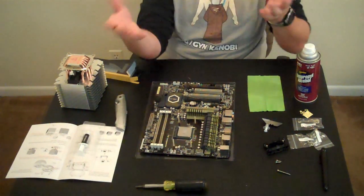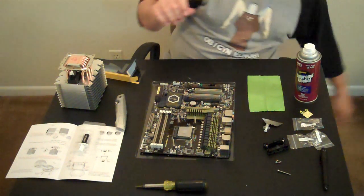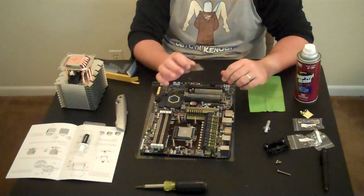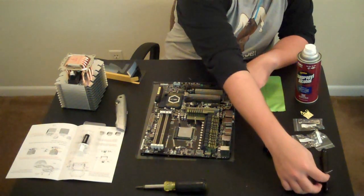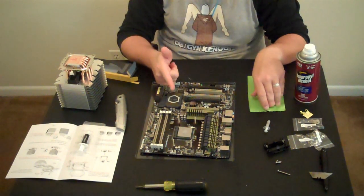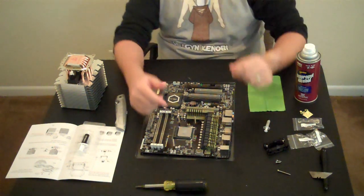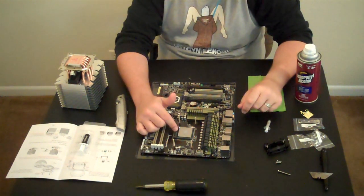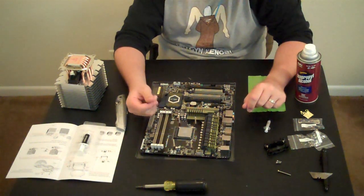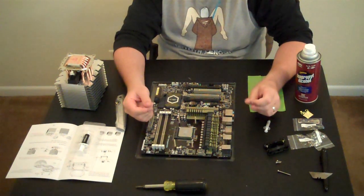Now, here we've got a learning experience. Since I'm not going to be using the old spreader to spread the thermal paste now, I'll clean that later. I need to clean the little bit of thermal paste off of the processor that's currently there. This thermal paste had a clay-like consistency — very, very thick, very hard to spread — not something you really want to fight with.